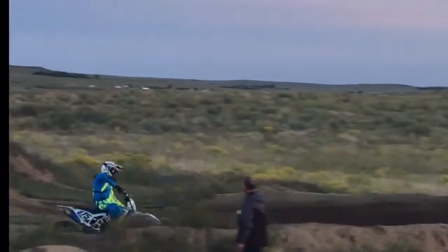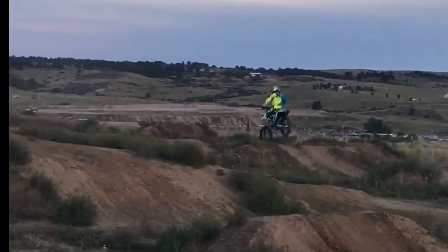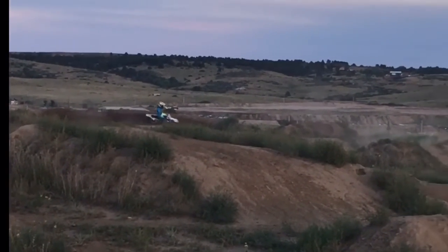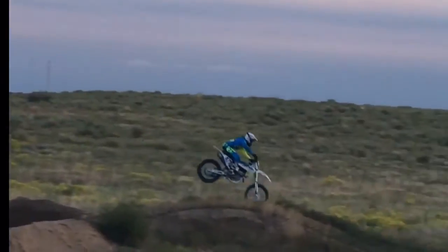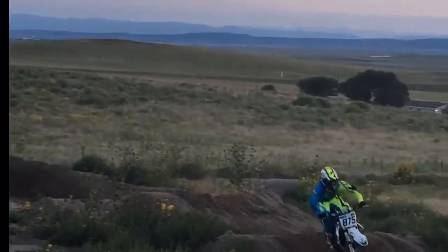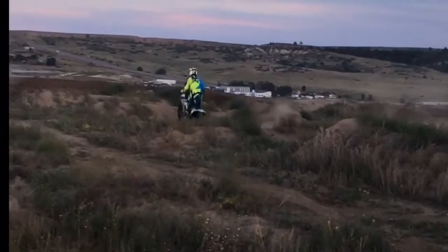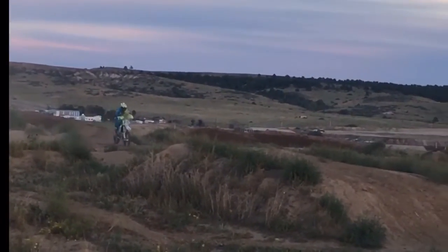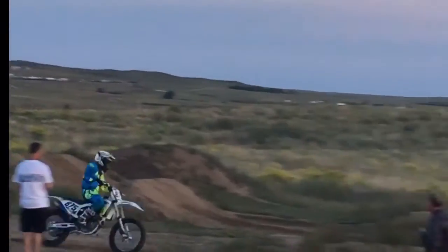Moving on to the hydraulic clutch — I've never had a hydraulic clutch before. Especially in supercross, I end up being really hard on my clutch and it ends up fading over the triple as I'm tightening it up. With the hydraulic clutch, I always have the same feel, which is awesome. What's nice is the Magura — if you tip over it won't bend the lever, it'll fold out. It also has a quick adjustment for lever height on both the clutch and the front brake.